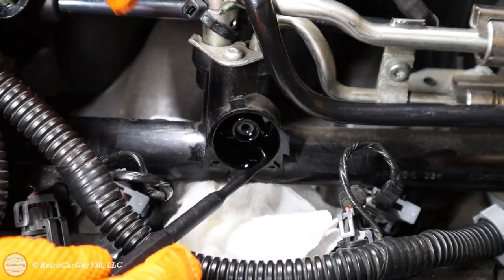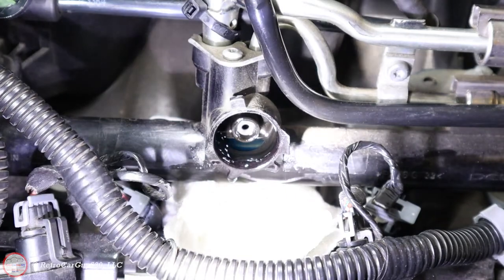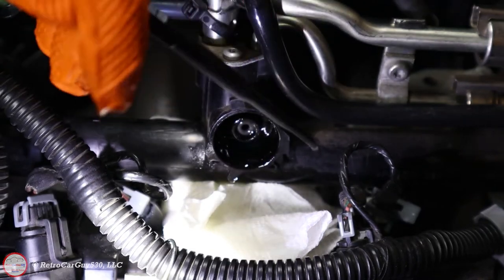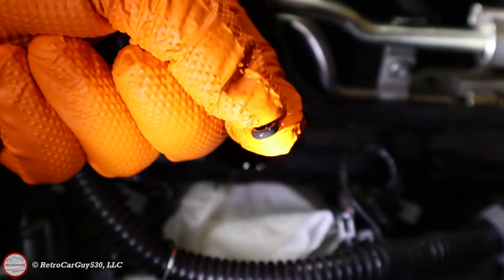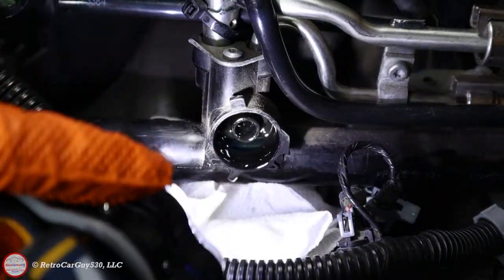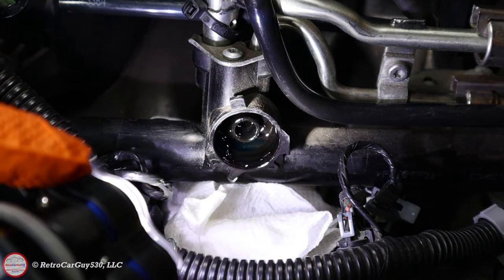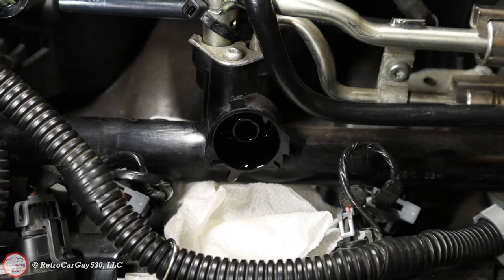There's the o-ring right there — that gray o-ring sitting right in the middle. I'm going to use the plastic pick carefully. I've seen metal picks used but be careful not to create a scratch in here while getting this o-ring out. And there we go — we have the o-ring out. Now I'm going to look in here for any obvious signs of contamination or particles. I don't see anything, just gasoline. So I'm going to proceed with the installation of the new pressure regulator.